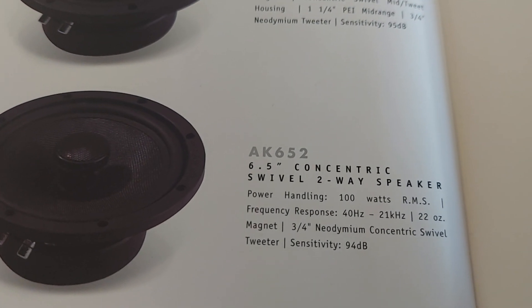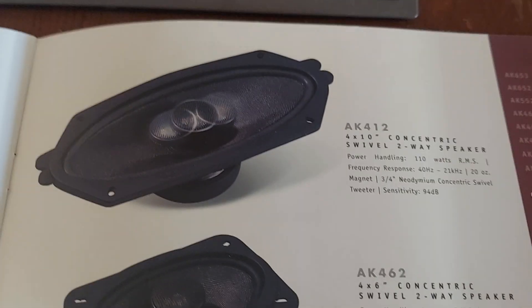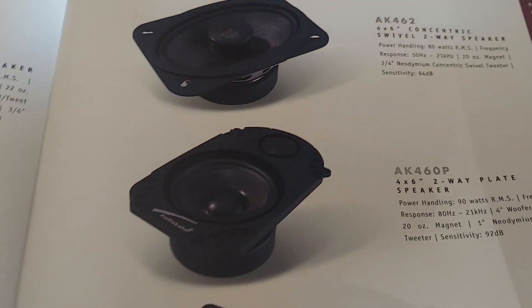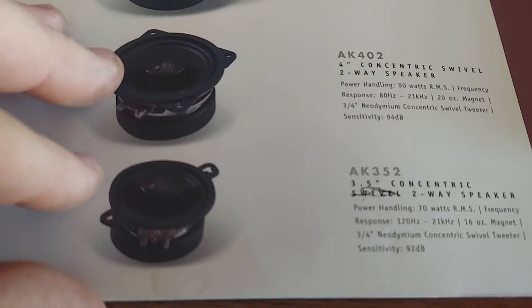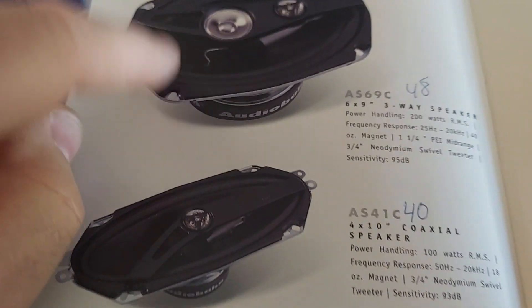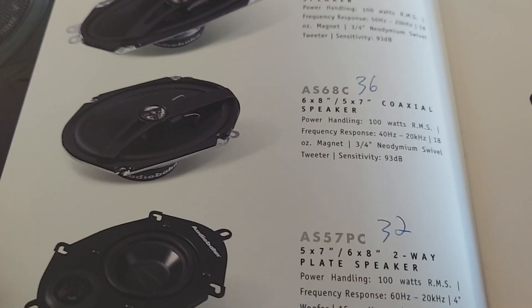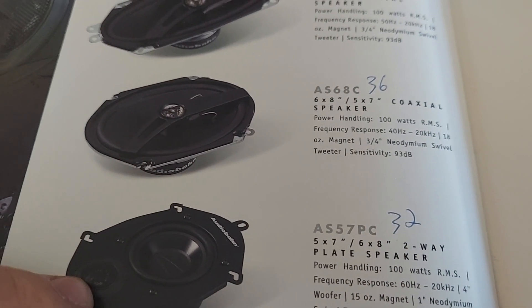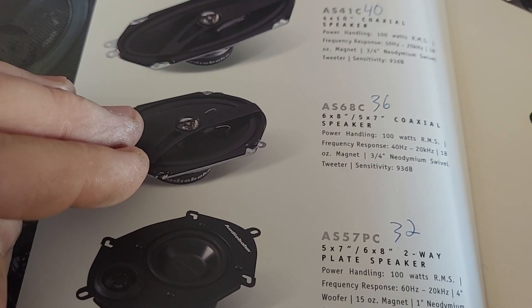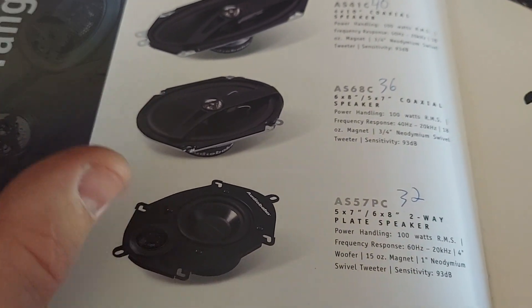That one looks really good — 100 watts RMS. Maybe with a high-pass filter. Definitely not full range. Look at that — swivel tweeter on the 4x10. For you Monte Carlo owners, old Monte Carlos, like '88 Monte Carlos, and some Cadillacs — I think they also use 4x10s. I bought a lot of these; I would sell them for a hundred bucks. They sell the 5x7 and the 5x7 converter plate. There was a review talking about how the sound waves produced by an oval speaker are different than those of a round speaker, and that is not true. The propagation is different, but in a small environment like a car, it doesn't matter — putting audiophile-level scientific tests on something used in a car is totally dumb.